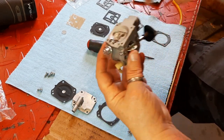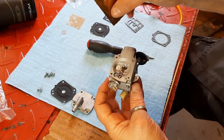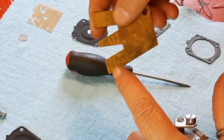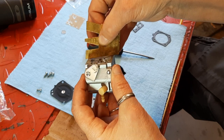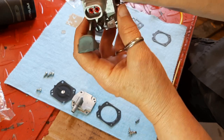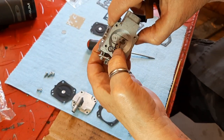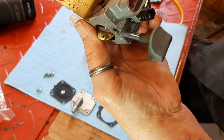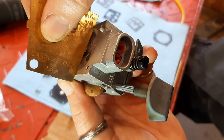Because we've put a new lever arm in there, we have to check the tension, because if there's too much tension it will keep it open. Walbro makes a handy dandy checker — you have to check this without the gasket on. These are the HD carburetors, so we want to double check and make sure that the needle lever is just flush with the bottom. It looks to me it is just kissing that, which I think is the perfect position.